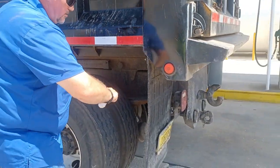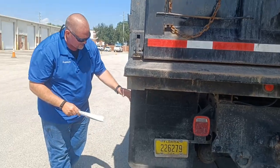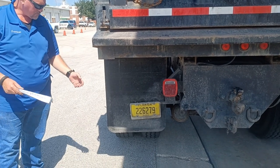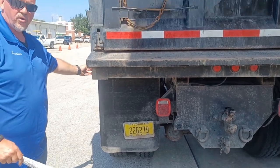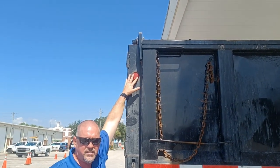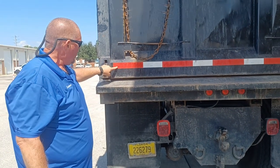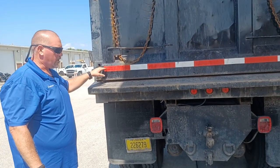We'll move our way back here — this is our mud flap. It should be affixed to the vehicle securely and should not be less than 80% of the mud flap remaining. It needs to be able to stop debris and rain from hitting the vehicles behind you. Moving our way back, we have these lights here — this is a marker light down at the bottom. The top one here is also a marker light, but since it's up here we can consider that a clearance light. On the back of this gate, we have DOT tape, also known as conspicuity tape. That needs to be adhered to the back of this vehicle 100%.